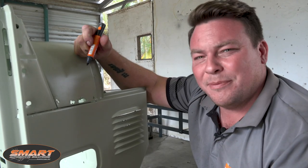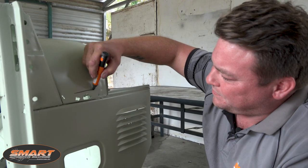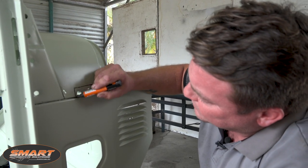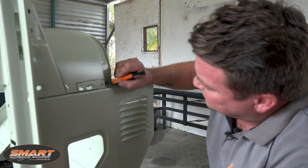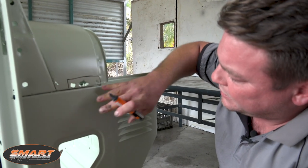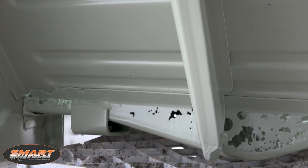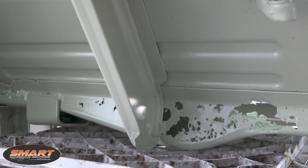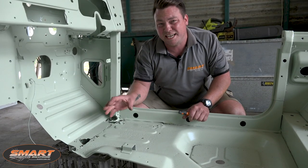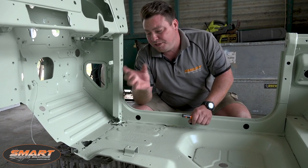This is a real hot spot with the 40s. If you remember, it was exactly the same as Milo 2 - it had exactly the same corrosion patterns. We might have to come back further but I'll have a look. Round about there, right round the corner here and down - that whole section round to there. You want to retain that little join there. Can't see here is the cross piece underneath - that's where the cab bolts to the chassis and it's actually really badly pitted with holes in it. We're going to find one out in the yard here that's got one that's half decent, drill out the spot welds and replace the whole section.